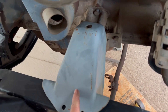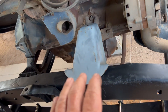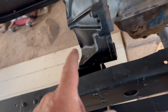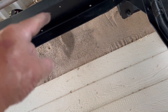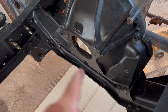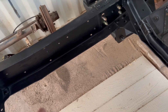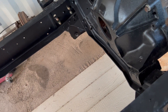I have to figure out how to do this — the engine needs to sit in its original location so I can mock these up. I doubt I'll be working on that right away, but it's an important step. We can then put a ZF five-speed in with a different cross member for the five-speed. This cross member will still stay — it's structural for the leaf springs and rigidity — we just have to add one here, and it could be something as simple as a tube and a little bell bracket.